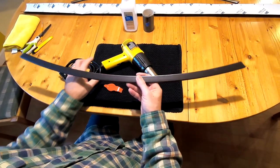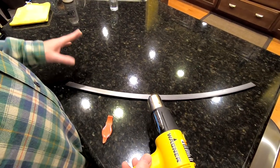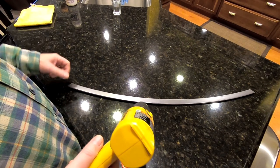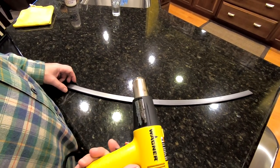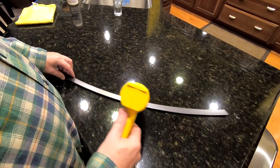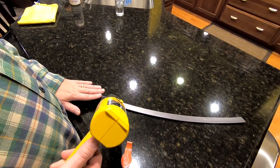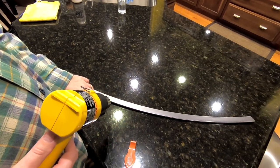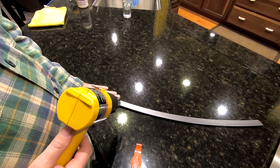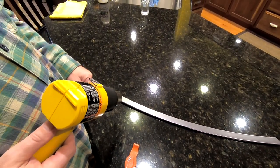I've moved to a surface that won't be hurt by the heat. Using the heat gun on high, I work my way along the face and warm it up until it's pretty warm but still touchable. You'll see some small bubbles form — not big ones — and any imperfection you can press into place with your finger. The material will feel a bit gooier as it heats up; that's the whole point of this step, the final smooth-out.